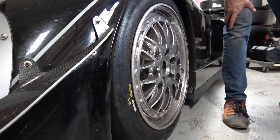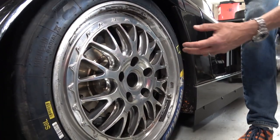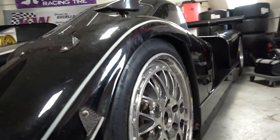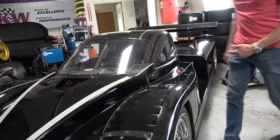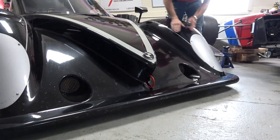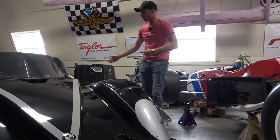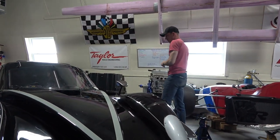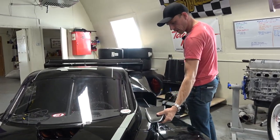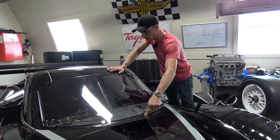Rather than a car going to do the 24 Hours of Daytona, it makes it a little easier. There are six-piston calipers here, with typical big steel rotors that are slotted and vented, and on a center hat with buttons — typical for the racing world. There are two big scoops down here for the front brakes. The headlight covers are polycarbonate clear but appear to have been wrapped on the inside silver, as they were mostly just running in the day. We actually have the lights over here in the spares. Really nice mirrors here on the aero tubing, probably chromoly — very nice carbon piece. This car does have a windshield wiper, not installed right now.